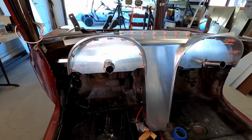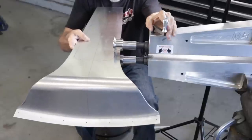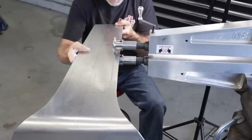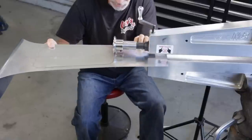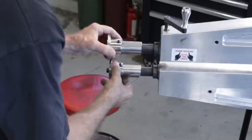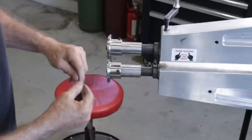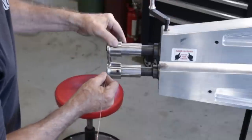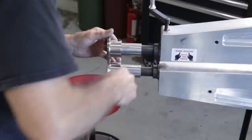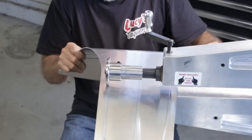The center section looks pretty good, but it needs a bit more excitement — so I'll add a step die in it. I didn't do my best with this operation and kind of messed up a couple of corners, but there's no turning back now. Because of the roll bend in this piece, I have to swap the die order to complete the operation, since the roll won't fit through the bead roller. I use 45 thousandths TIG wire to act as a gauge for the die separation. To keep from leaving start and stop points, I roll on the pressure while moving forward.